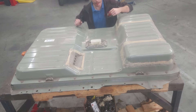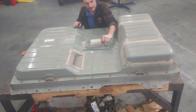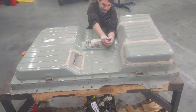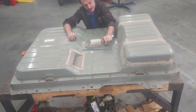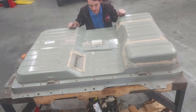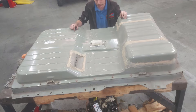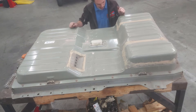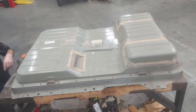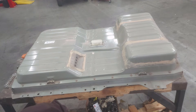We're going to pull the central plate off — these have got a security Torx, I believe they're T30. They're on there pretty tight. We got that plate off. Unfortunately the camera quit filming right in the middle of that, but we got it off. Now we're going to pull off all the rest of the bolts around the perimeter — these are all 10-millimeter, and then there are I believe four 13-millimeter bolts as well.